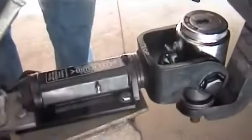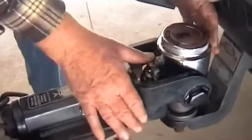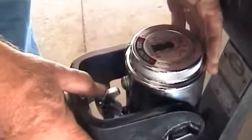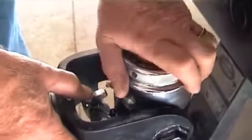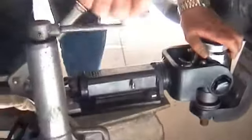Now that you've rolled on, you're ready to lower the coupling to full engagement. Press the button, which is the automatic secondary lock, rotate the lid 45 degrees, and then just wind your jockey wheel down.